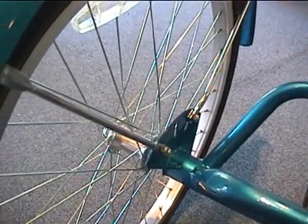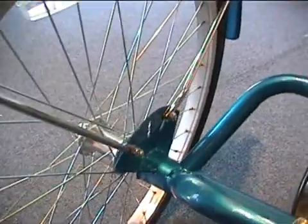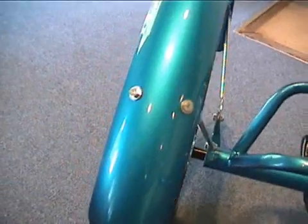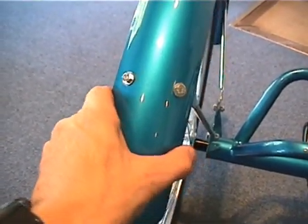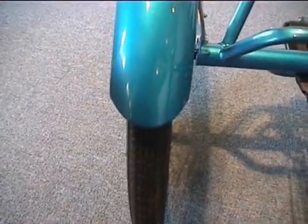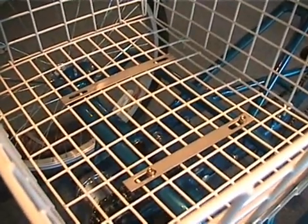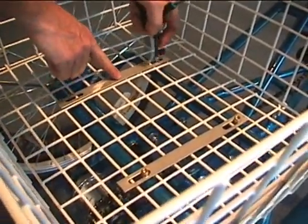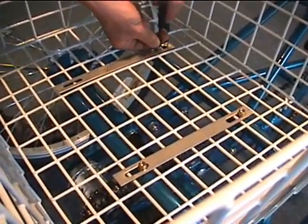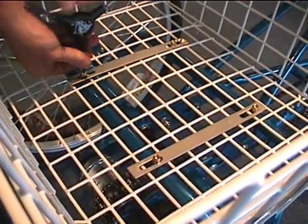The next process is the rear fender assembly. 2 bolts on the front bracket, 1 bolt on the rear bracket. Tighten them down, and occasionally the brackets will need to be bent by hand to clear the tire evenly. The assembled basket is then mounted to the bicycle using the 4 Allen bolts, centering the basket on the frame and securing.